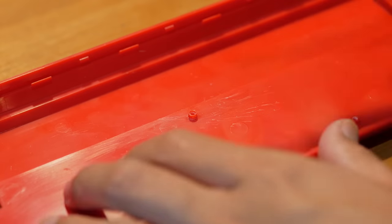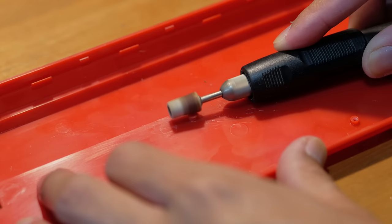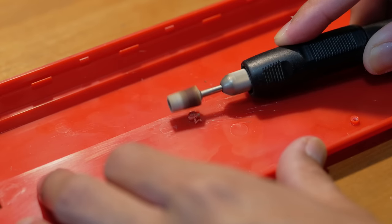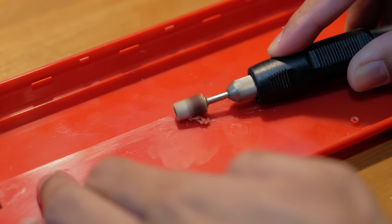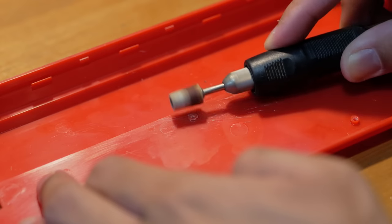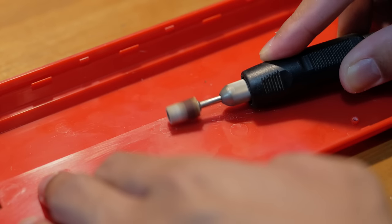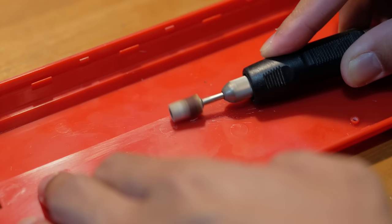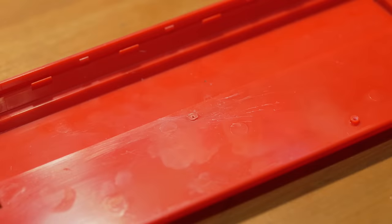Now the bottom piece, this is a classic tray mount design, meaning that the PCB is screwed to the bottom of the case. This can result in an uneven and also harder typing experience. The bottom mount is harsher where these points are, and especially with a steel plate, it doesn't really give that satisfying Ducky experience. So one thing we can do is remove that middle standoff. Whether it makes a difference, I don't know, but whatever.